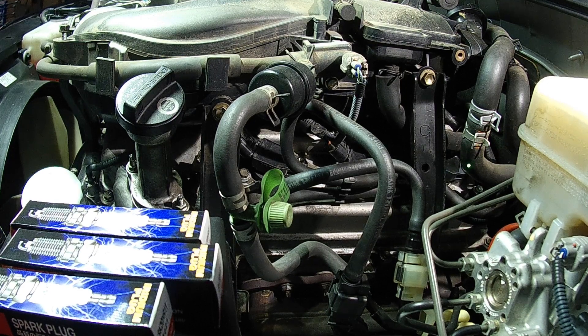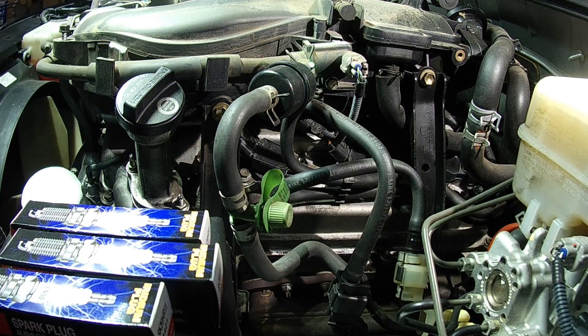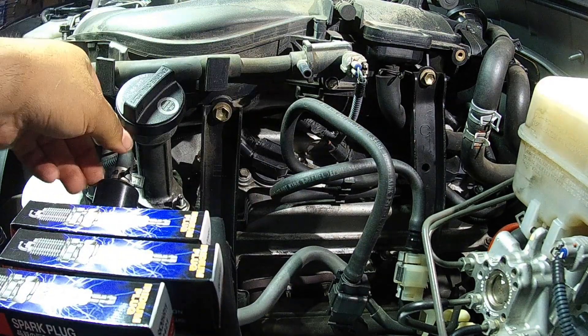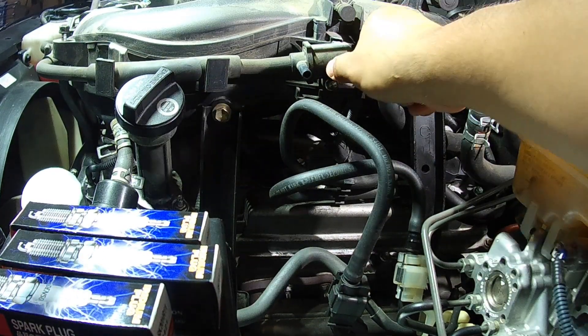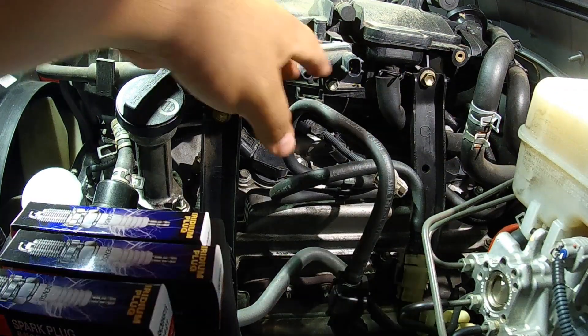On the right-hand side of the screen, see the green laser? That's one of the coil packs. Next one is right in the middle, and one right here at the top. Some of this stuff is in the way. This EVAP line right here — you need to move that out of the way. Squeeze that with your hands to get it out. You have this plug right here, also part of the EVAP system — squeeze this and pull that out of the way.